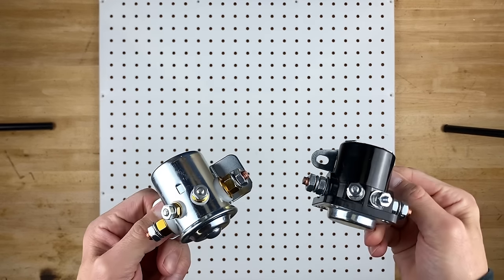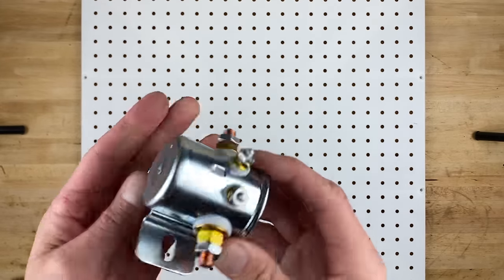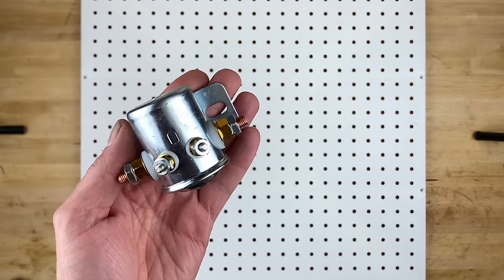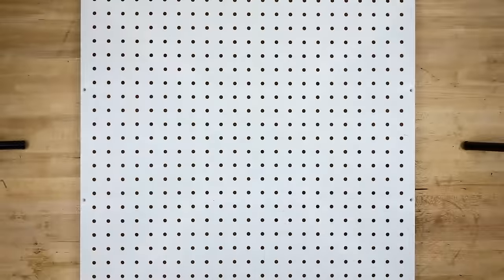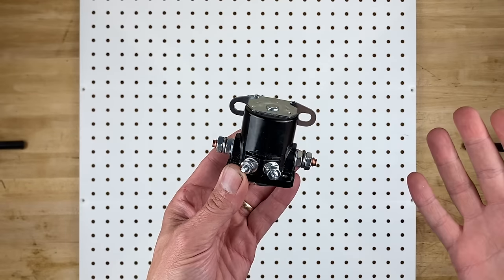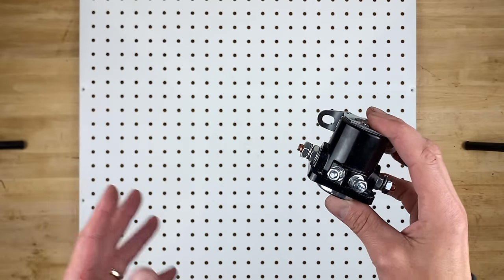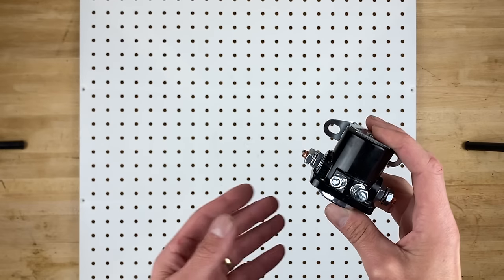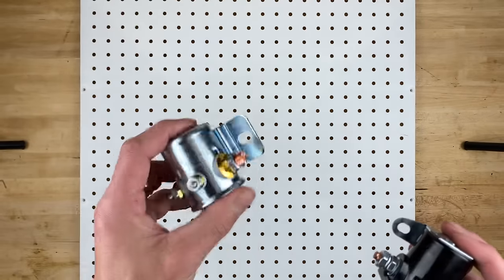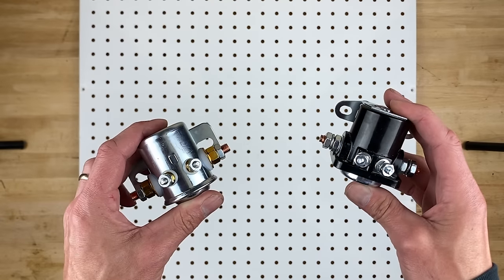With the board cleaned off, let's talk about solenoids. This right here is a genuine Cole Hersey 200 amp continuous use solenoid, part number 24213, and a continuous use solenoid is great for powering up fuse panels or anything else you're going to keep on for a period of time. This right here is a generic Ford starter solenoid and it is not meant for continuous use — just meant to turn the starter on and then let it turn off again. If you were to have this power up a fuse panel with a lot of electricity flowing through it for a long period of time, it's not meant for that. It'll fail internally, cause a meltdown, and then you'll have a bunch of problems. That's why this one is about eight dollars and this one is about fifty dollars — one's continuous use, one is just meant for short bursts of electricity.